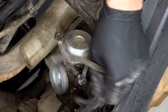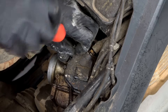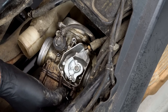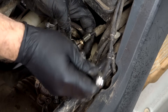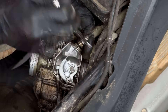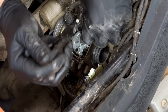We've got a few different vent hoses we need to disconnect. We need to do the throttle and the choke. The throttle is actually behind this plastic cover, held in by a single Phillips. Lift that cover up and it just pulls out. We can go right to where the cable goes into the top of the carb, push that boot up, and just loosen that pinch bolt. Once you've got that, back it all the way out, feed it through the channel, swing it around to line up with the other channel at the bottom of the arm, and pull it straight up.